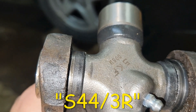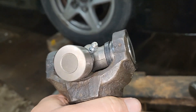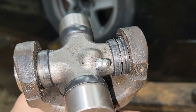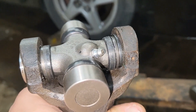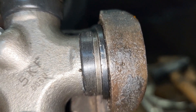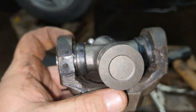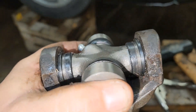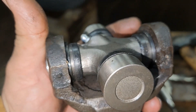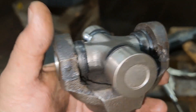Got the snap ring in that one. We'll beat this one in just a little bit more, then get the snap ring on it, and we can put it on the driveshaft and put the rear U-joint in — again same thing, 1350 to S44, or whatever you want to call it. Both snap rings are in. I took the caps off and wiggled it in there, then put the caps back on and carefully tapped them together, because there are needle bearings in those caps — they'll fall out or get crooked.